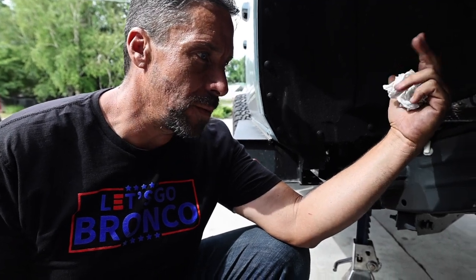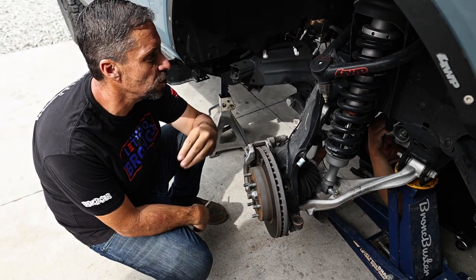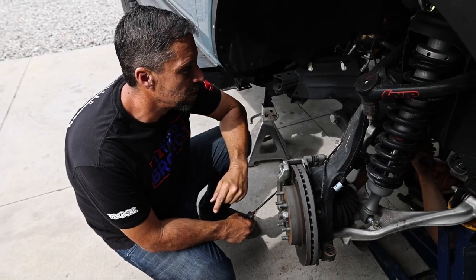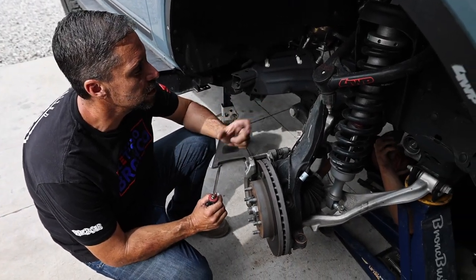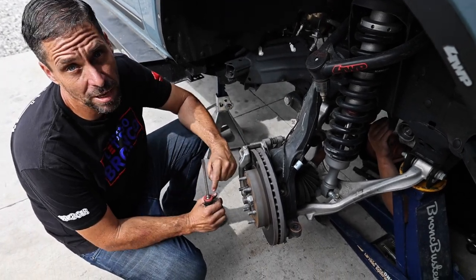There are a total of seven T30 Torx screws — six of them are in the front and then there's one in the back that you'll have to go to the back side to get out. Remember all seven of those. All of this hardware gets reused on the installation of the new part, so make sure you keep tabs of those. We'll bring it up on the table — we've got to reuse a couple of parts off of that old housing that'll go onto the new housing as well.